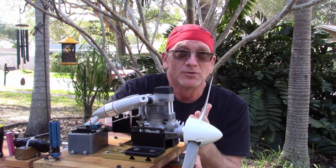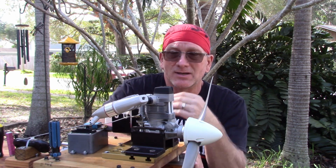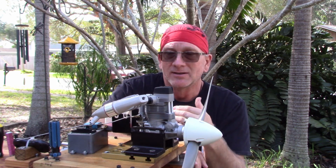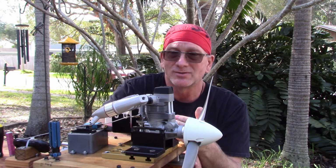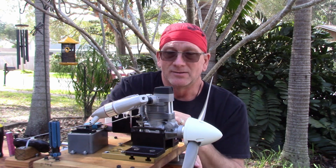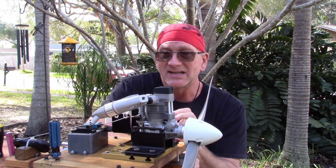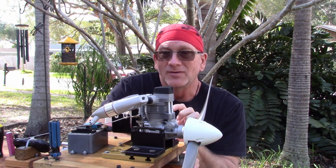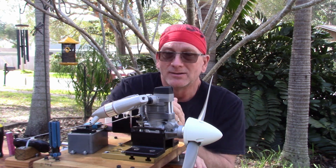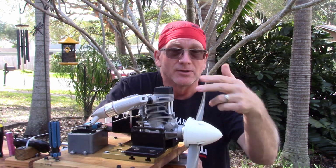So there were times where it really went low, I opened it up too much, and then I would lean it out too much because it took time, maybe 3-4 seconds, for it to catch up with the adjustment, which any non-pumped four-stroke engine I've ever run has never taken that much time to show. So that was a challenge for me on this run, to see how much of a movement would be required to go between what they say is near peak, and then maybe 2,000 RPM lower to cool it down. As you can see, something happened during the run.